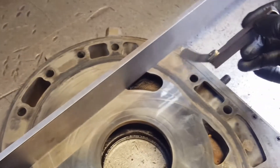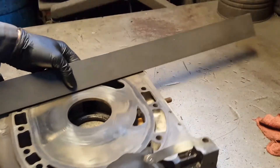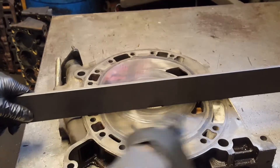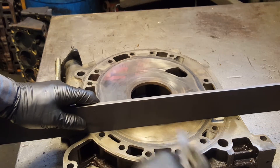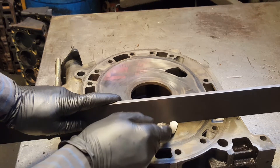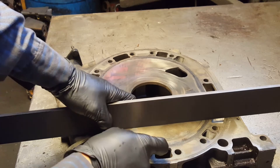The 0.004 won't go in — so we're good. This iron is within specifications and is reusable. Let's flip it around and check the other side — between the water jacket on the flat part. Grab the feeler gauge again — still good. So yeah, this is how you check your irons. This one is fine.